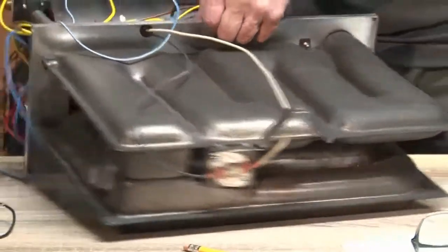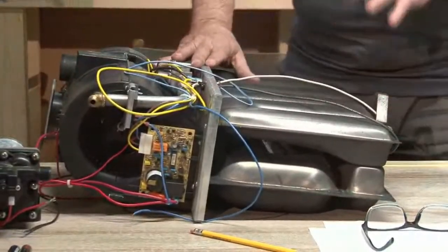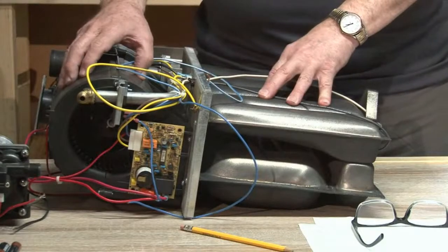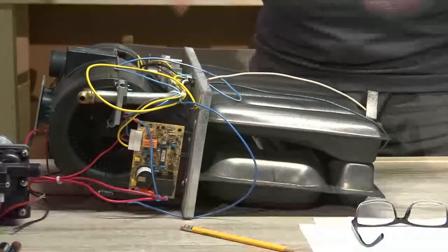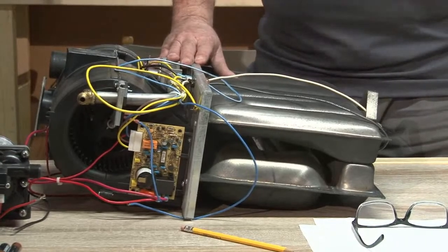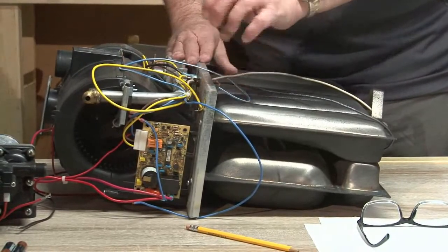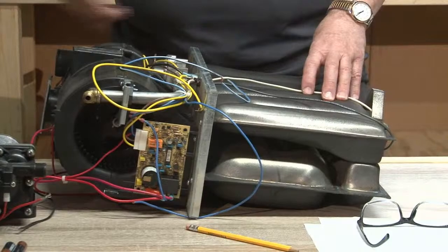So what we see a lot of times happening with a furnace like this is the batteries are crucial for this to operate, because it has to have this fan going at a certain speed. So if it works the first time and it shuts down after that, and then it doesn't work after that, the very first thing I would check is your thermostat. If it clicks, do you hear a click in your furnace down here, because it's going to say, do we have enough power in here? Does your fan start? But it just doesn't get going.